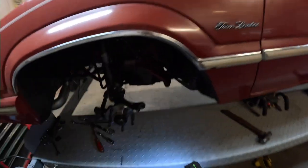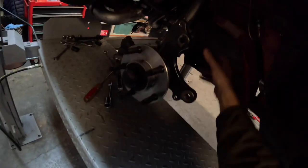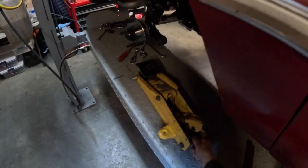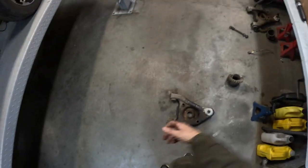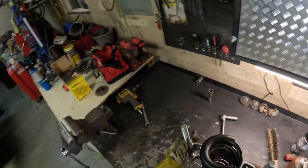When I get the control arm in here, I've got my air jack and we can lift the car on this side to give us more room for our control arm to pivot. We've got to get the spring in there — the further it goes down, the better access we have. Secondly I've got my jack here where I took the wheels off, and I'm going to use this to jack it up and get our ball joint stud into our spindle. There's going to be a lot of tension, so we jack this up, get our stud in here, get our nut on there, and then it'll hold everything in place. Alright guys, big moment here — I've compressed the spring, it's about 14 inches from the original 16, so we're going to see what happens here. Hopefully this goes okay — I've got my setup ready to go.